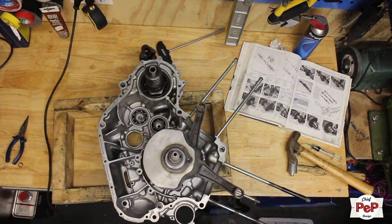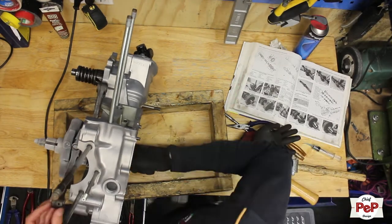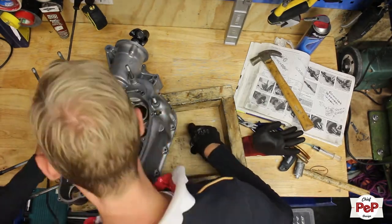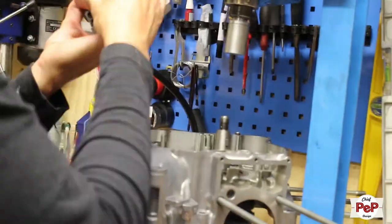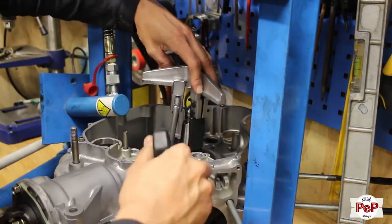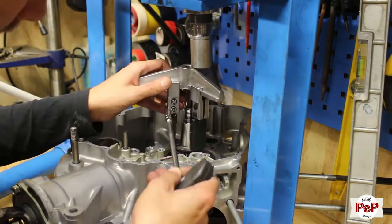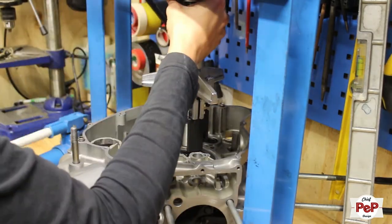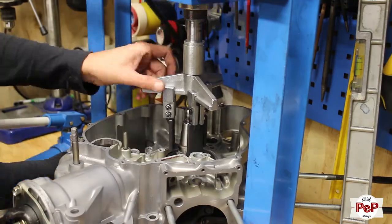As you can see the shaft just falls in like that. Now since the crankshaft is still frozen I hoped to install a really hot oil gear on it at the same time. I had to carefully tilt up the engine half to get there and be careful that the heavy shaft wouldn't fall out of place while it's still cold. I noticed soon enough that this wouldn't work and I would have to do it with my hydraulic press anyway. I figured I would use the same puller tools to press the gear back as I used to take it off. With these forces it's really important that you constantly check if everything goes on straight and you don't damage anything, especially not the crankshaft. Therefore it's very important that the pressure is only on the shaft and not on the cheeks of the crankshaft. I constantly adjusted the puller to make sure every side gave the same pressure. Then the oil gear was in place — I still hate this gear because it's a real pain to get it on or off.